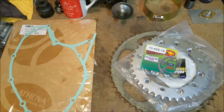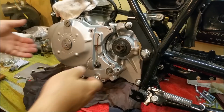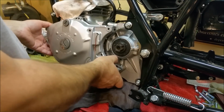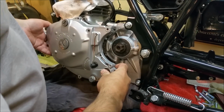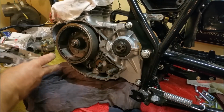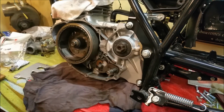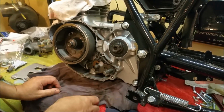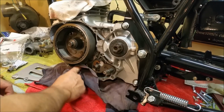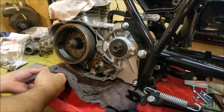I think I'll pop that cover off and just bang a new gear shift seal in and put that gasket on. This has got magnets in it, so it's going to be quite challenging to get off. I'm just going to push that in and withdraw. And we've got to operate on this too. We've got to cut those connectors and put new ones on and give it a good clean with an old rag, to get rid of all that muck, which I should have done already.